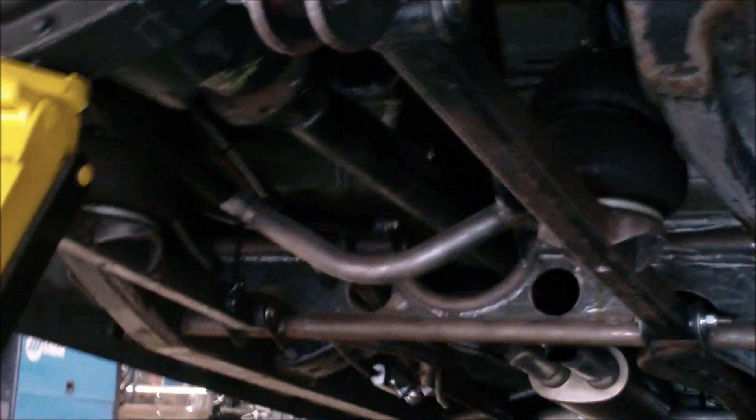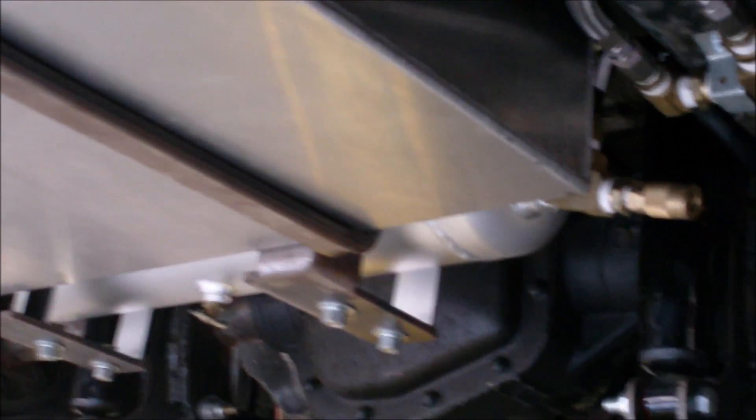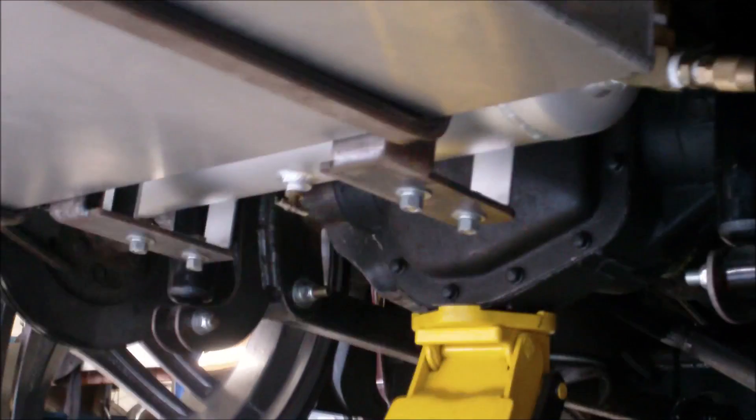The customer has some wicked plans for the suspension and chassis. Once he starts dismantling it, they're going to powder coat it — keep the body black and powder coat the frame and chassis in a sick color that I'll let be a future debut; I'm not giving that one up. All the electrical is tied up in here: zero gauge going to a split, then splits to four gauge feeding two 80-amp relays, and then goes to the compressors. Still a little cleanup to do, but testing is done — 350 miles on this thing.